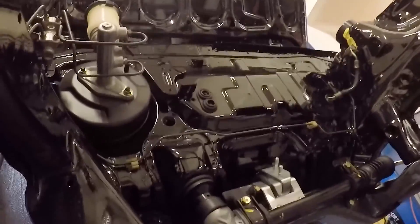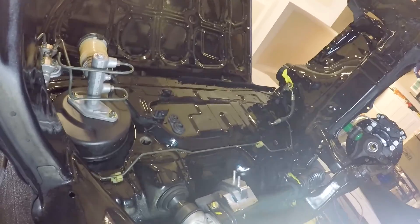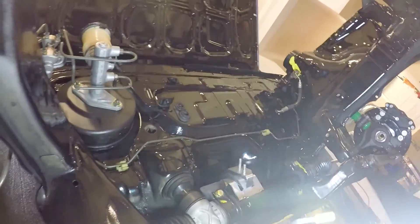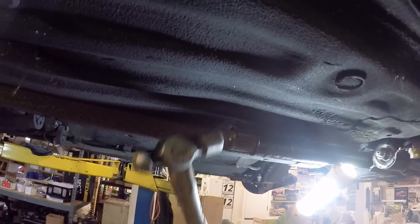The paint mark is on the bar towards the inboard side. I'm going to slide this in until we see it line up — you can see where the keyway is and we've got our paint mark right on it. Now I should be able to tap this bar just in a little bit to engage those splines.